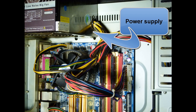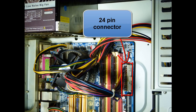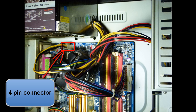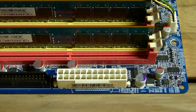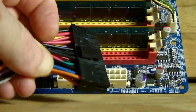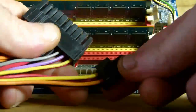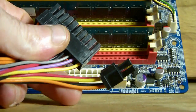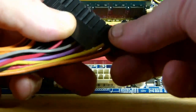The next job is to connect your power supply to your motherboard. There are two connections to be made: a 24-pin connector and a 4-pin connector. If you have a new motherboard with an i3 processor with turbo power, it will be two 4-pin connectors. The 24-pin connector usually comes in two sections — one side has 20 pins and the other has 4 pins. The reason for these separate connectors is that some small form factor motherboards only use 20-pin connectors, so the option is there for those motherboards. Always check your motherboard user guide for this information.